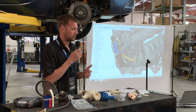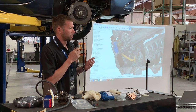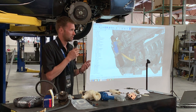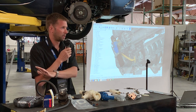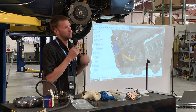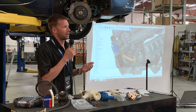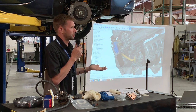As far as the coolant ratio, we probably should have put more coolant in, to be completely honest, because it's not good for water pumps to run on just water. They need lubrication, and that comes from the coolant, the antifreeze. This is a core anyway. No one's reusing this water pump. It was pretty ugly in there to start off with, so I don't know if it could have made it much worse. And we just went through more and more water. So we would have been throwing away antifreeze, and that's the price of development sometimes, but we would have been throwing away a lot of it for not really much of a reason. So to answer your question, we just used water for the vast majority of it.